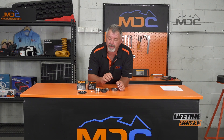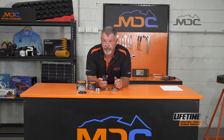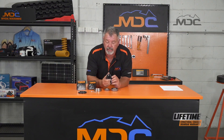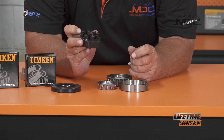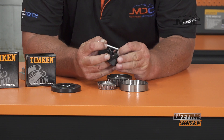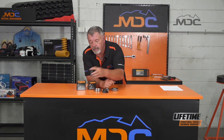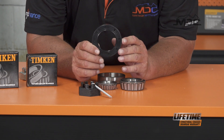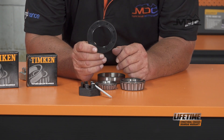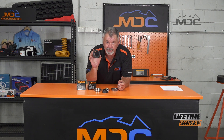Because it's a parallel axle, you can't run down to your local Repco and get a Ford or Holden crown nut. The MDC axle uses a very large unique crown nut, so you need to keep that as a spare part in your kit — one for each side, so carry two. The split pin is enormous and you're not going to generally pick that up at your local hardware or spare parts store. The seal is also quite large, so you'll need to carry spare seals. Just about every MDC model will come with spare crown nuts, spare seals, and spare wheel studs and nuts in the kit, so they should be in your camper or caravan when you get it. If you've used them or you don't have a set, make sure you get them as a spare.